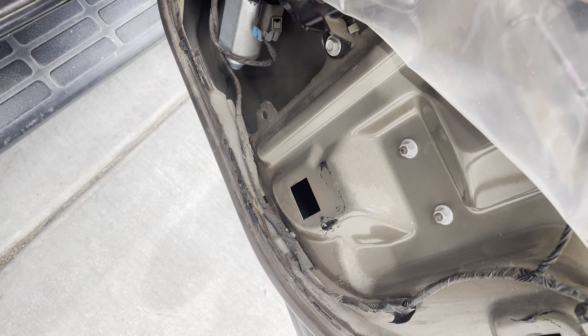These holes align so let's get this out. The heaviest part is this bottom part where the motor is. The wiring harness is actually clipped in right here — the wiring harness has a plastic little clip. I need to pry that out with the flathead. There it is — now we got it out.